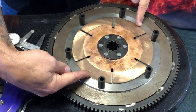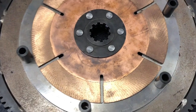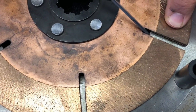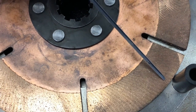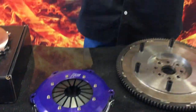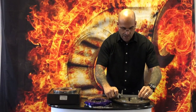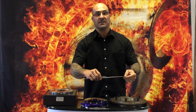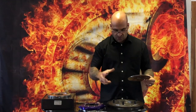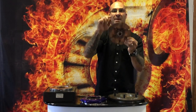The diameter of the actual clutch is 184 millimeters. If you look at the spacing in there, draw your attention to the minimum side of the friction plate — there's enough flywheel over there to make sure that your entire friction face mates onto the actual flywheel itself. So if we take the 184 millimeter wide clutch plate and take off the friction face area, the inside diameter that we make our flywheels to is 125 millimeters. That'll be a guide for you as to what diameter you need your actual flywheel to be on the minimum inside face, to make sure that the entire friction face of the sintered copper clutch mates onto your flywheel.